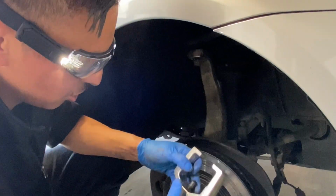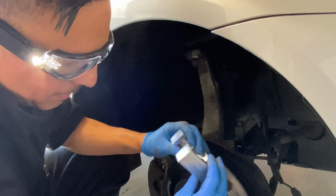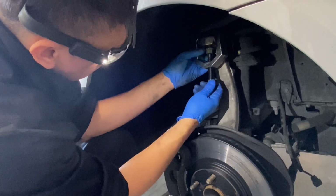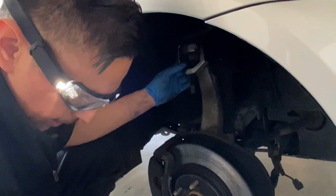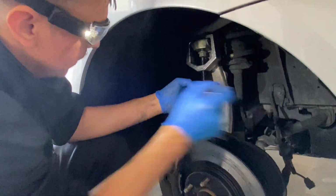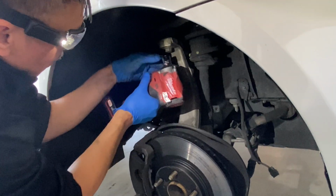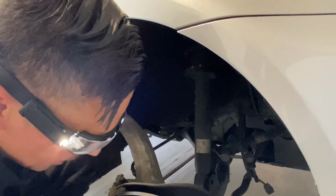So anyways, long story short, you gotta go get one of these Pitman arm removers and slide it over and use the nut as a guide. You don't want to ruin the thread. So as so, put it on. All right, let's see. Here we go. Oh, that was easy. That one came off. So some of them don't come out easy like that. Bam, it's out of the way. Look at that, ready to go.